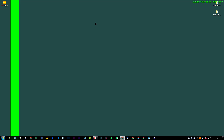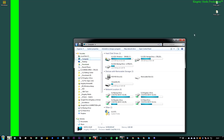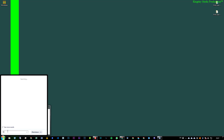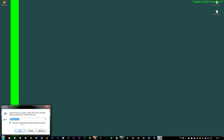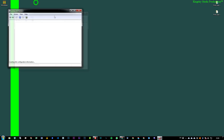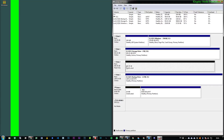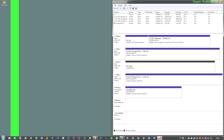Now we need to sort out the new drive and allocate it. If your drive was already used it will be allocated, but if it doesn't show up in Computer you need to follow this step — otherwise skip it. Press the Windows key + R, or type 'run' in the Start menu, then enter 'diskmgmt.msc' and press OK to open Disk Management. Disk 2 shows as unallocated — that's the Crucial SSD. Right-click and create a New Simple Volume. If yours says 'Read Only' on the left, you won't be able to do this.